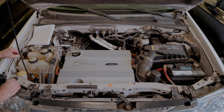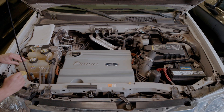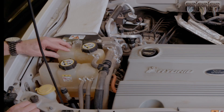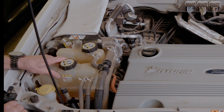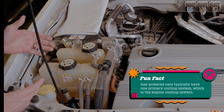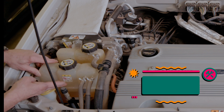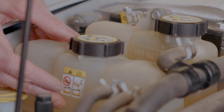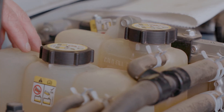Now that we're on the other side of the vehicle, let's take a look at some things that we can look at without needing a mechanic. You'll notice that this vehicle has two coolant reservoirs — that's because it's a hybrid. This has a cooling system for your internal combustion engine and also a cooling system for the battery. They are set up pretty much the same: they are clear so that you can see the level of the fluid inside, and you want to make sure that level is within the limits of the actual reservoir itself.